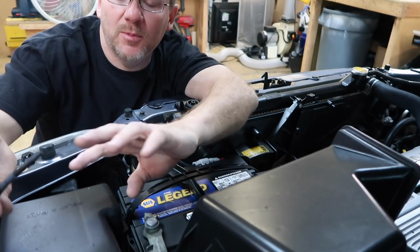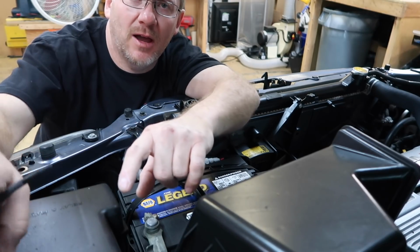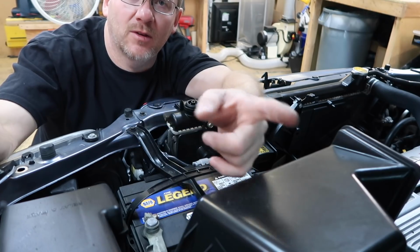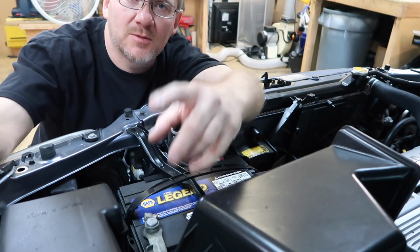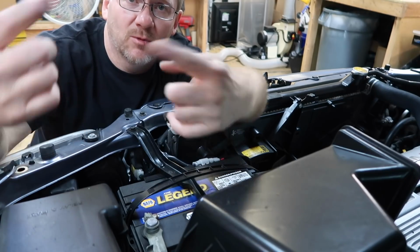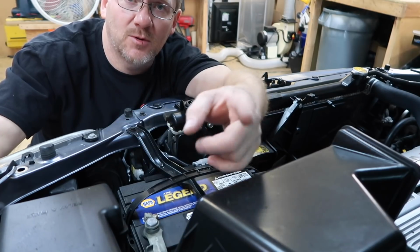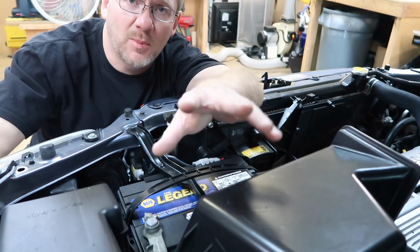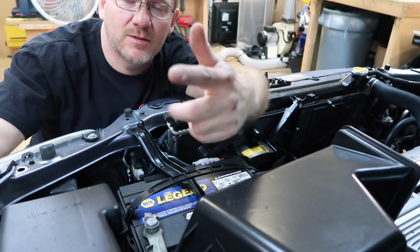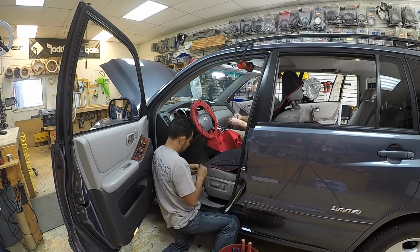The wire made it all the way up to where the fuse relay box is, which is perfect because we'll go ahead and make our connection behind this box back here with the wire that we run in from the car that goes behind the radio. We're gonna stop at this point as far as this install goes because Fernando likes to pick up at this point. When he runs the rear camera wire forward, he'll go ahead, drill a hole in the wall and grab this one and run those all the way up into the radio. To keep on pace though, what we're gonna move over to is the bench, and we're gonna get the kit and the harness and the radio mounted so that when we're done, we're all meeting at one point.